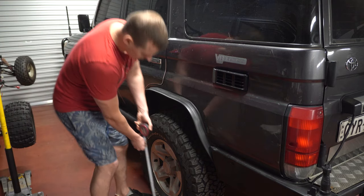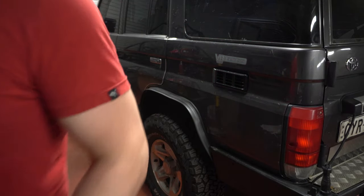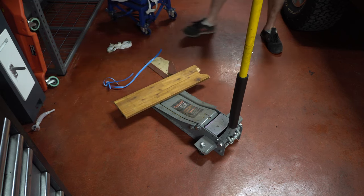I've already noticed some issues, which I'll get to later. But first I'd better take the car apart. Before then, I'll document all the measurements I can so I have a good comparison to see if these are actually better. The first step is to measure the height of the wheel arch, to make sure I don't crash into my garage roof when I drive home. I'll make that 960 millimeters. I'm also going to try to flex up the vehicle and measure the angle of the cab while it's flexed. I've pre-planned by spending many hours building an over-engineered flex-providing device. So I'll jack up the car and see if I can get any meaningful information out of it.